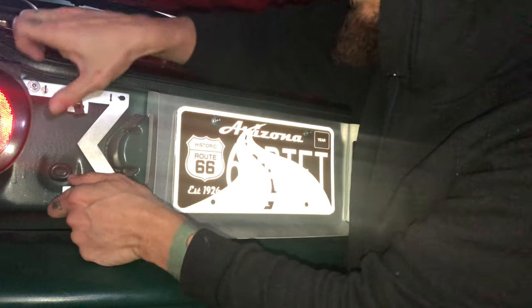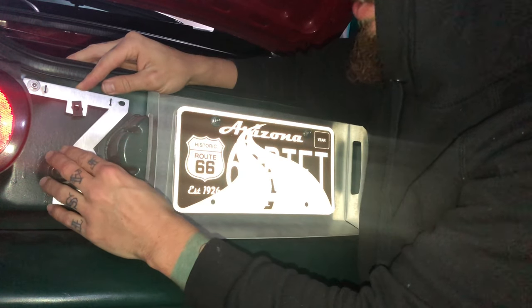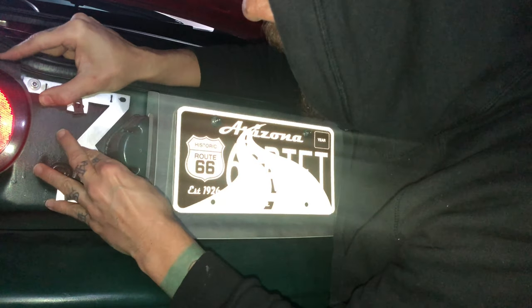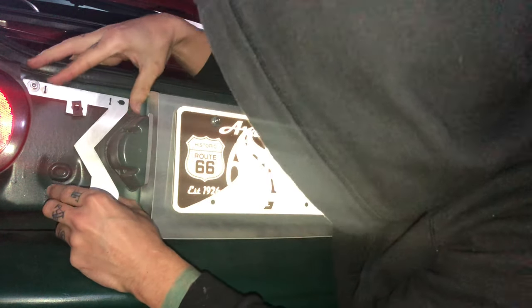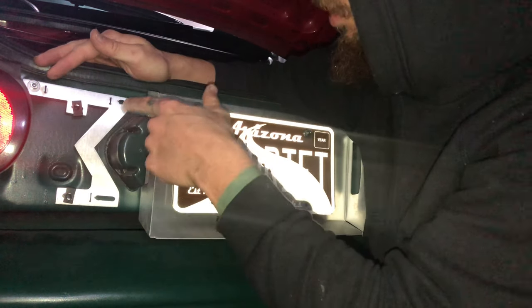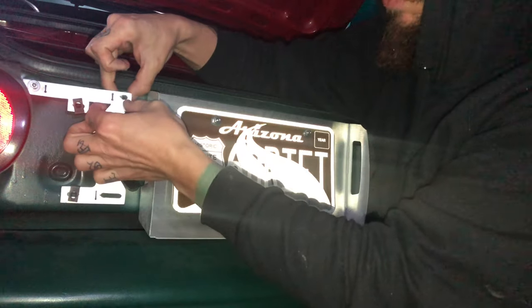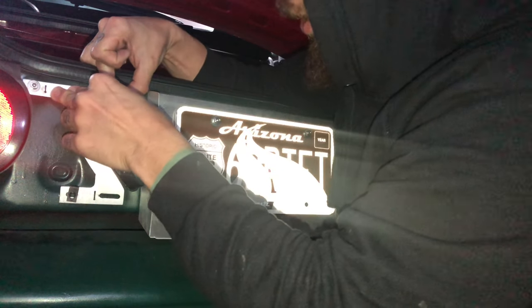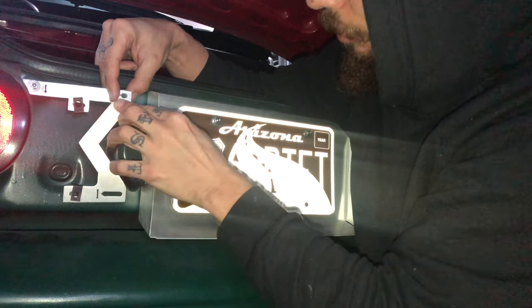As far as LRB Speed was concerned, see how this moves up and down? That hole just moves around a lot. What I did was take the little indentation and line it up the best I could, then maneuver it down and tried to make the space even using my finger on each side. Then I took the spacer, put it behind the bracket to start bending it out, and manually bent it to form it into place so that it would fit. Bend that up a bit, bend this out — and there, now you can see that fits into place.